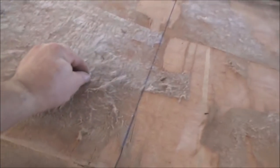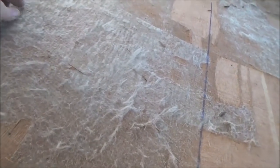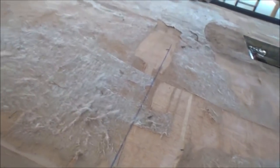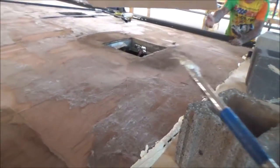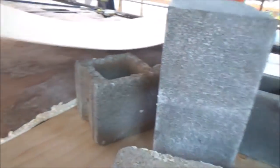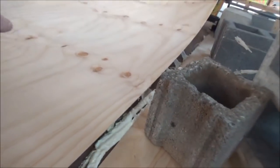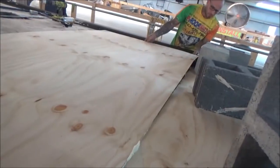One of the reasons we're re-decking it is because this is fleece — this had a fleece-back TPO on it. It was a cheap one but it still was a fleece-back. So if we go along this thing with our adhesive that we roll on, that'll all mat up and wad up and you'd see clumps up underneath us. We're going to lay another sheet down, get this all ready to cut for the pipes and stuff, and then glue her down. So we just cut out for those pipes down there.